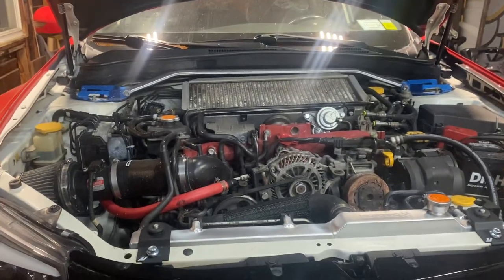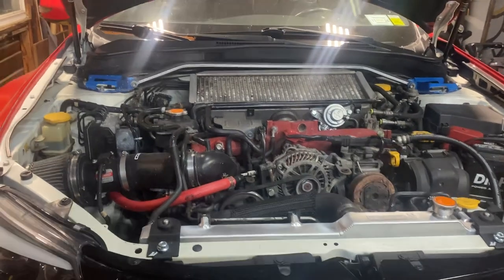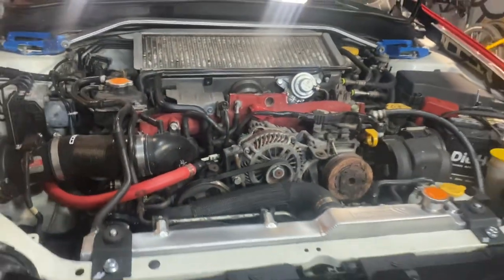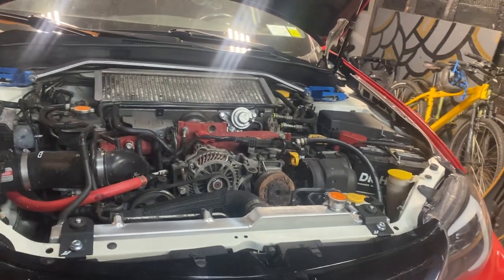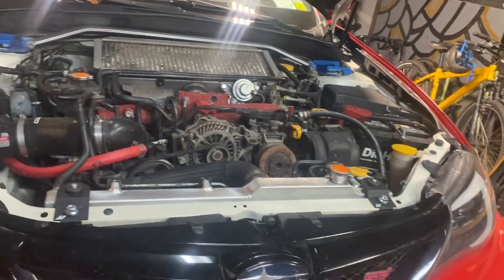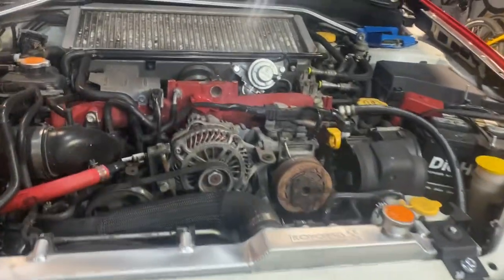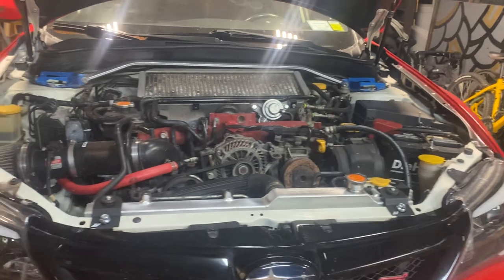Next, I'm not sure what I'm doing next really. I think I'm going to do the blow off valve. Oh, I need to actually finish — there's no coolant in here yet, because I'm adding the extra line to the cylinder head. People call it the cooling mod. Apparently you can tap into cylinder head four for an extra coolant line, because apparently it dead ends there and creates a hot spot. So I decided to do it, especially since I have no water in there now. So that is next, and I'll make a video.